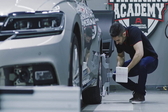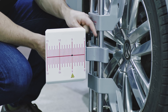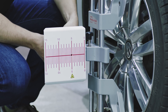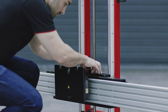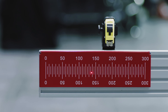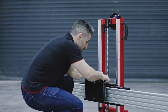Insert the connecting shaft of the laser into the clamp port. The laser calibration board should be facing the front of the vehicle. Tighten the bolt to secure the laser. Turn on the attached lasers and adjust them so the beams light the rulers on each side of the crossbar cover plate. Loosen the handle and rotate the fine-tuning bolt until the rulers on each side of the crossbar plate have the same value lit by the laser. Tighten the handle to secure the crossbar.